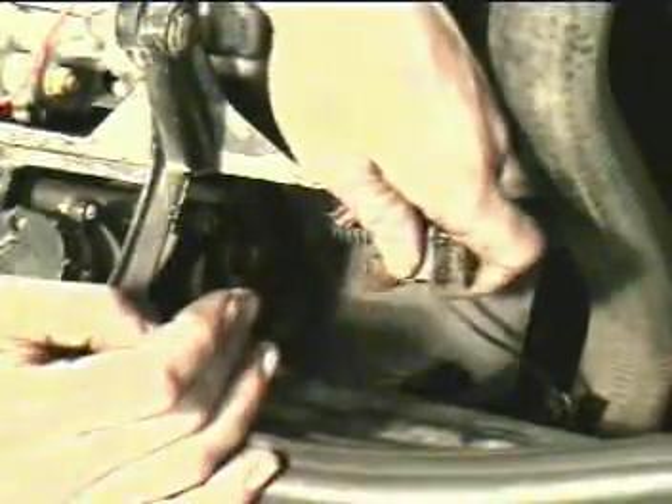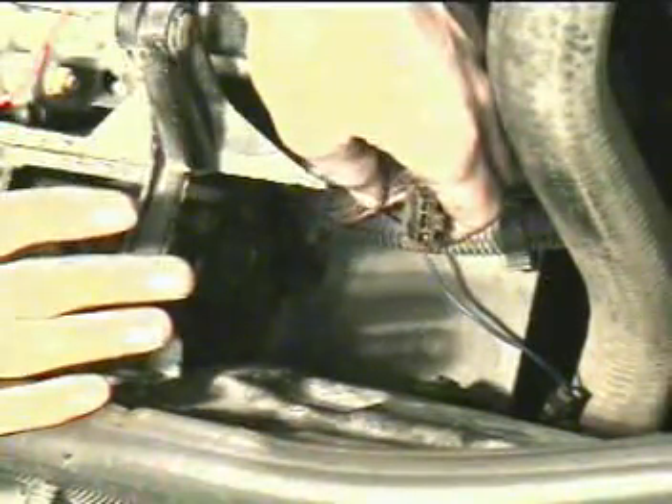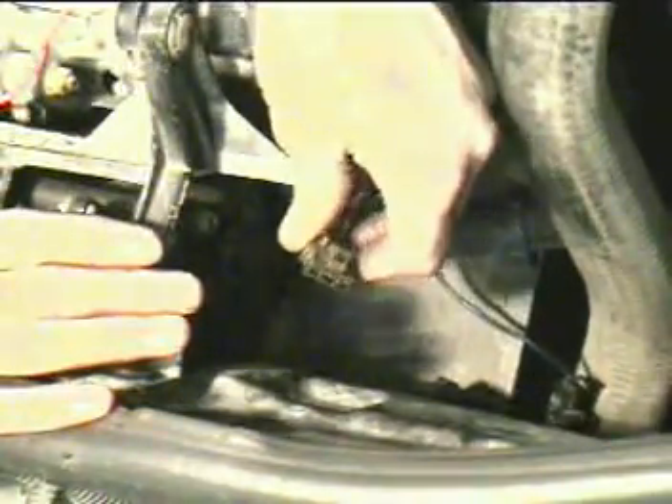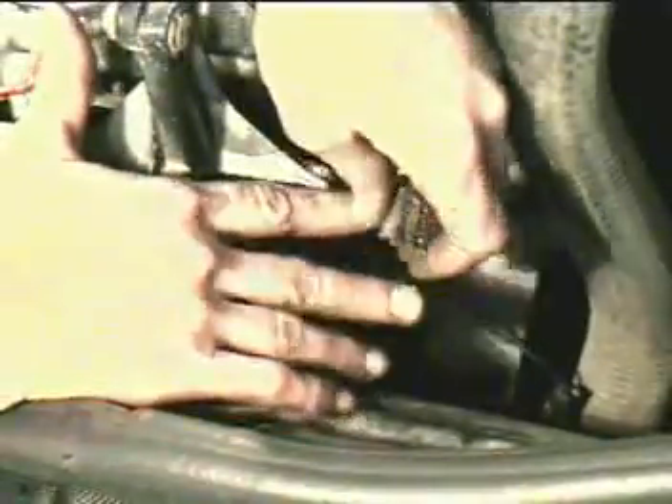For this test, be very, very careful. On the three-wire plug, the red is always going to be hot, and it is wired through a fusible link. So if you're doing this test and you bump your hot wire to a ground and you burn up your fusible link, you're going to call me a bad name — so be very careful. First, make sure you've got power at the red wire and a good ground on the black wire, using your test light or bug box. I've got power at the red wire and ground at the black wire, so I have to assume that part of the car's body harness is good.